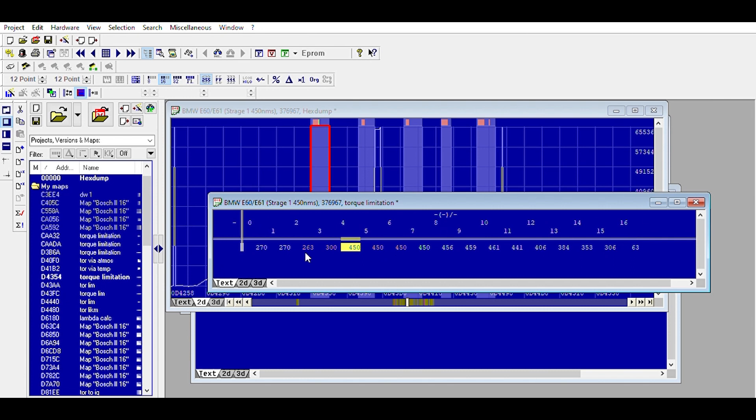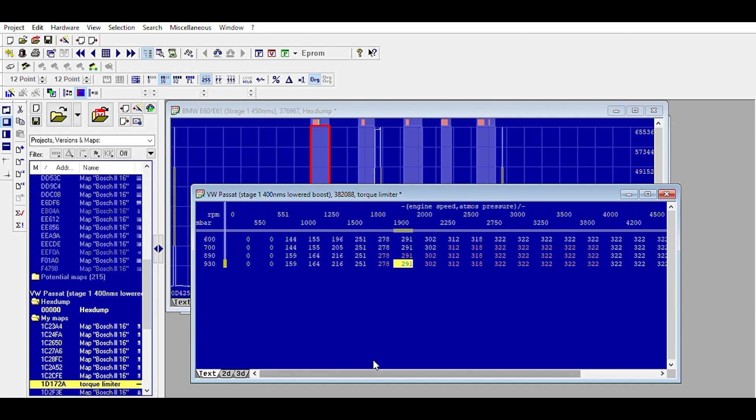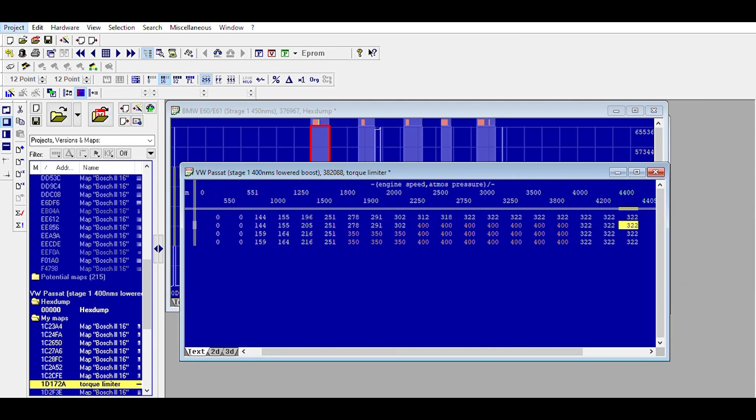So they would see about 450 Newton meters of torque, which is not completely unreasonable to see. But the most important thing about torque maps is being careful about where you're increasing the torque. If the car is manual, you want your peak torque hitting at about 2250 RPM. This other tuner decided to think that 320 all the way to the end was necessary, which is not correct.